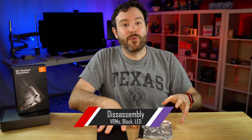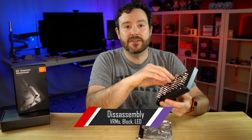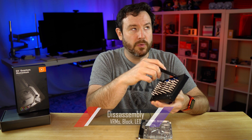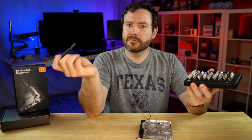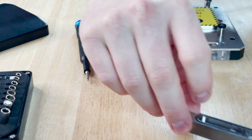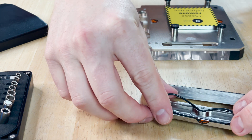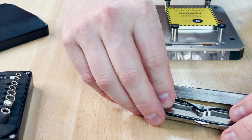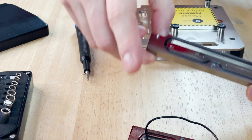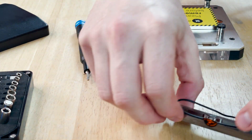One of the things I really like about EK is the fact that so much of their stuff can be disassembled. The first thing I took off are the MOSFET and the VRM cooling solutions. This right here is the gasket cover — you can see how it's supposed to be. We'll have to fix that one and get it back inside the chamber itself.